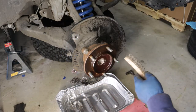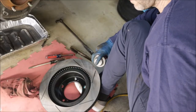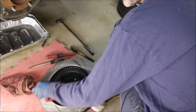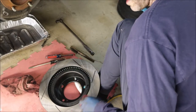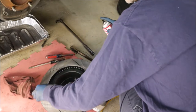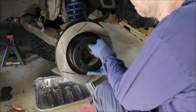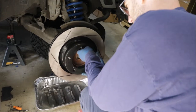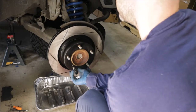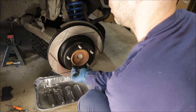Clean this up with a little wire wheel. Then just a little brake cleaner to get the shipping oils off the face of the new rotor. These don't seem to be too bad, but sometimes you'll get a rotor that's covered in oil inside the packaging. You'll want to clean both sides of the rotors before you put those brand new pads on. Put a lug nut in place to kind of hold the rotor on so it's not flopping around when you're trying to mount the caliper.